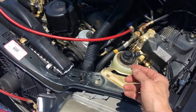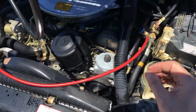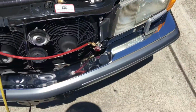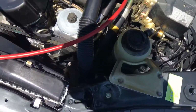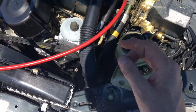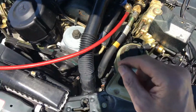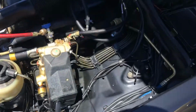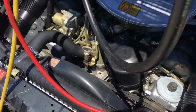This way, when it's just been cleaned, I have to go over it with a fine-tooth comb with my refrigerant leak detector, trying to find where the leak is, instead of relying on the UV dye, because they usually clean this particular place. They do such a good job. They even remove my UV dye, which usually they don't. But this one does an extra good job of cleaning.